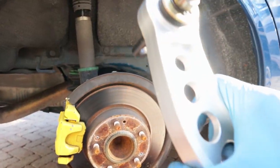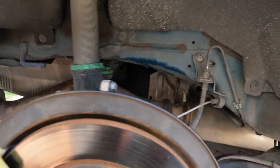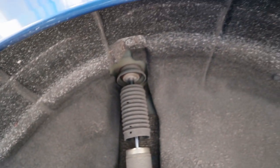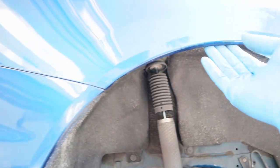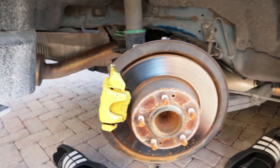So what I'm going to do now is just measure my stock arms to see the length and then put everything back. The next side — the driver's side — should be cake because it has the most space; the passenger side has no space. I'm hoping I can get zero degree camber when I go get an alignment. I currently have like negative 2.5 degrees of camber, which is stock when you lower the car. I'm trying to get to at least like 0.7 or 0.8, something less than one degree that's not going to cause rubbing.